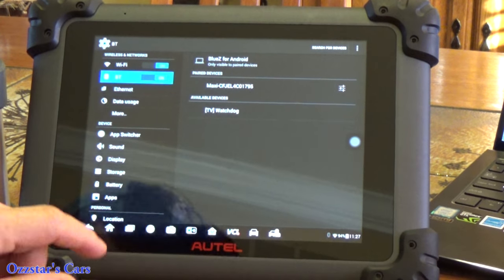For example, if your air mix motor is out of calibration, this tool has the technology to handle that. If you want to reprogram — replacing the actual software — that can be done through this tool for many cases without going to a separate OEM website. Coding means changing settings in an existing module. Reprogramming means starting fresh with blank or updated calibration. TSBs — Technical Service Bulletins — from the OEMs can tell you whether something needs replacement, recalibration, or a software reflash. This tool can code directly; you need the J-Box for programming.